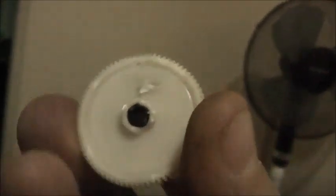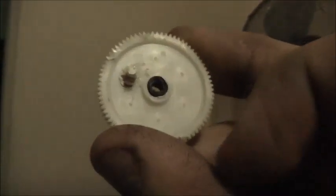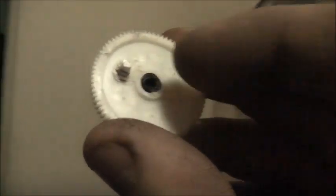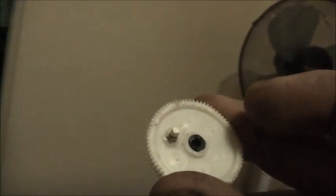And I drilled out one of the markings here — you see the little circles, little dots, six of them. Well I drilled one of those out, welded a bit of plastic in there. It's a plastic standoff that holds the diffuser behind the LCD of a TV. A little bit of plastic — I just rolled it in.